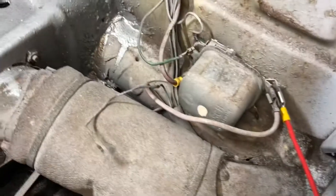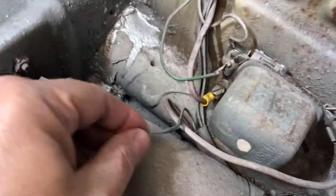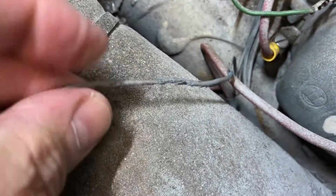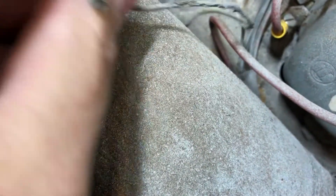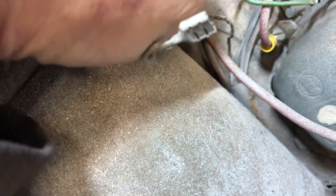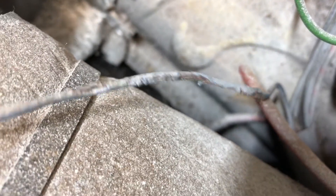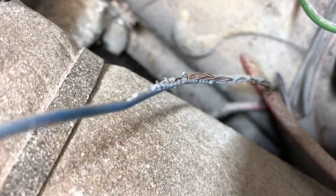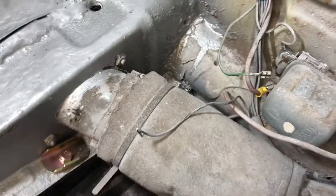This is your DF wire — it plugs into the regulator right there. With an alternator you don't need it anymore; this blue wire goes to the light in the dash. These two will connect together on an alternator. As I was finishing my alternator conversion and coming back in to attach all these wires, what do I find? The mice have pretty much eaten up this wire, and it was laying against ground — grounding out and making my generator light glow in the dash.